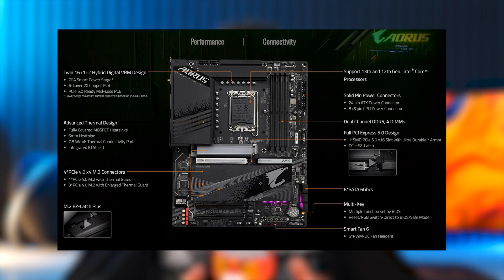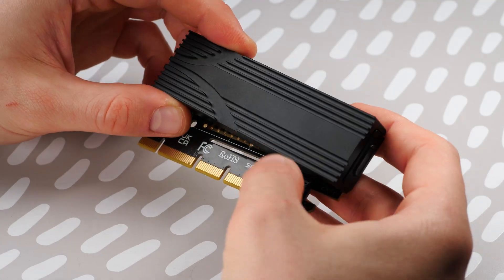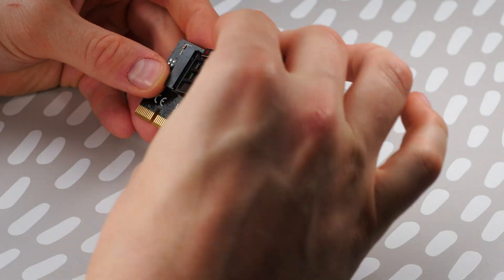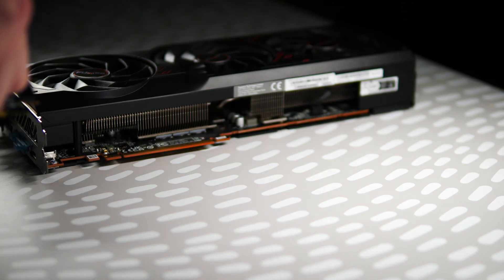For those interested, this is the system I ran the tests on. Compatibility might be a challenge depending on your system — a lot of CPUs already support PCIe Gen 5, but many consumer-grade motherboards still use Gen 4 M.2 SSD slots, with Gen 5 usually available only on higher-tier gaming motherboards. This was the case for me: I have a Z790 motherboard with only one PCIe slot linked directly to the CPU for the graphics card, so I had to buy a special PCIe 5 SSD adapter from Sabrent, remove its built-in heatsink, and swap it out with my graphics card.